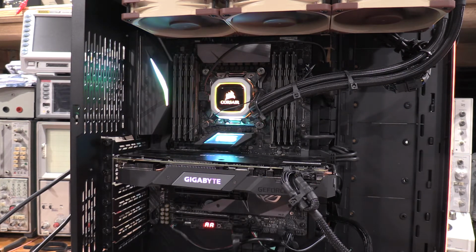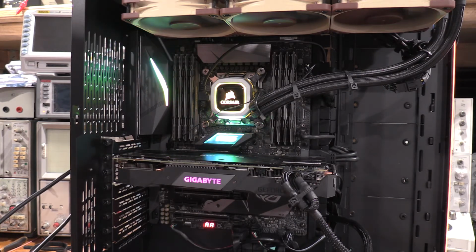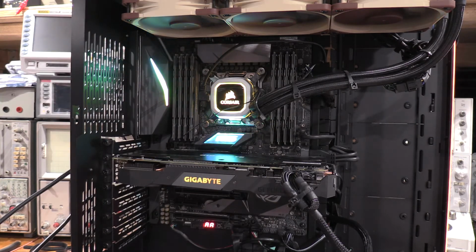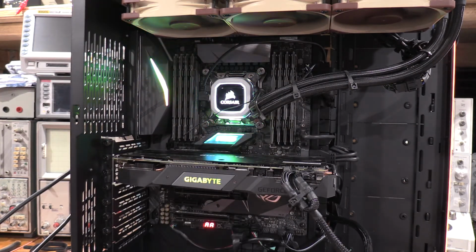Gonna shut down this machine, hook up a keyboard real quick just so I can turn it off. Then I will finish putting on the hard drives and everything like that. And we will then create a RAID array, which essentially is going to be turning on the computer and letting it chew for probably 6 hours or so, because of doing a long format and an initialization on this RAID array. It's going to be 8 terabytes redundant, because it's going to be four 4 terabyte drives, so it's going to take a while to initialize and build that. So we'll get it shut down, and then I will pop the 4 hard drives in. We'll be good to go.